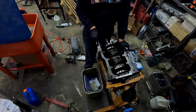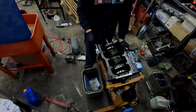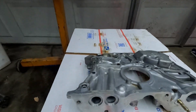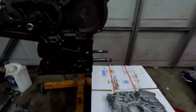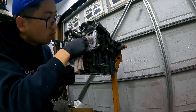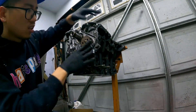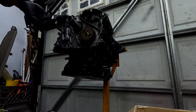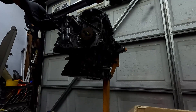Now that that's all done I'm just gonna scrape off the silicone. Now that I have the rod bearing, crank bearing, and thrust washer bearings changed and clearanced and within spec, I think I'm gonna go ahead and put on this oil pump. Now that we have that set in place, we're just gonna torque it to 69 inch pounds.